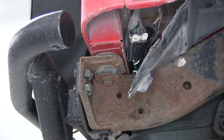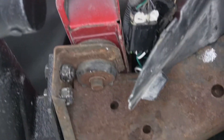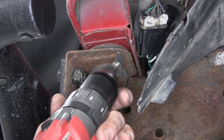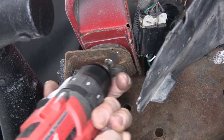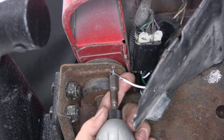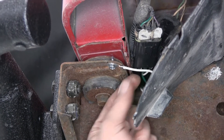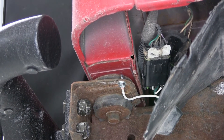Now that we've got that hole drilled, let's rough up that surface a little bit. You could use sandpaper or a screwdriver, but I'm just going to use a little rotary tool — just get it cleaned up so we'll get good contact there. Get the wire back in, and then since we bared that metal up, we'll clean it up just slightly.